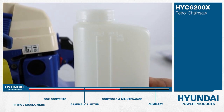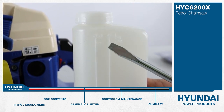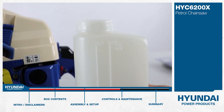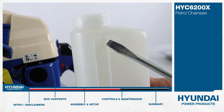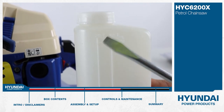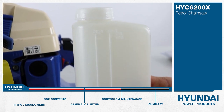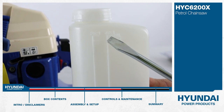Then we could take our two-stroke semi-synthetic oil, top it up to where it says the oil line, the top one here, and that will give us the 40:1 ratio. So rather than underdo it with the oil, slightly above is always better than slightly below the line. It won't hurt if you put a little bit too much oil in, but it will hurt if you don't put enough. So obviously you don't want to go double that amount, but be accurate with it. Fill your fuel to here, top it up with oil to that.